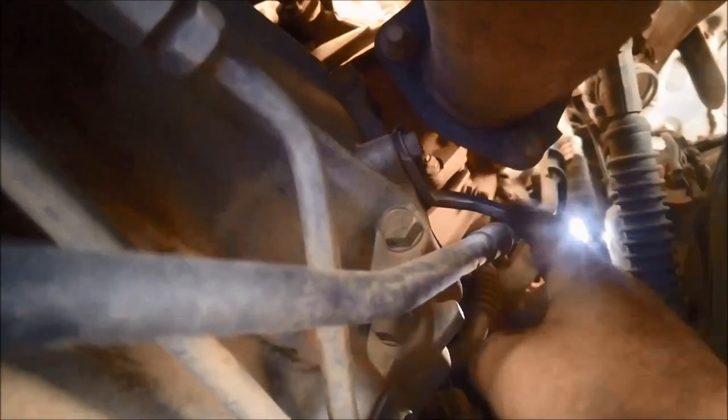If you don't have a vacuum pump, you can loosen it at the drain plug there. Now with these, the filler tube — or half of the filler tube — comes off with the pan, so just make sure you clean up where the join is before you take it off, as well as around the pan.